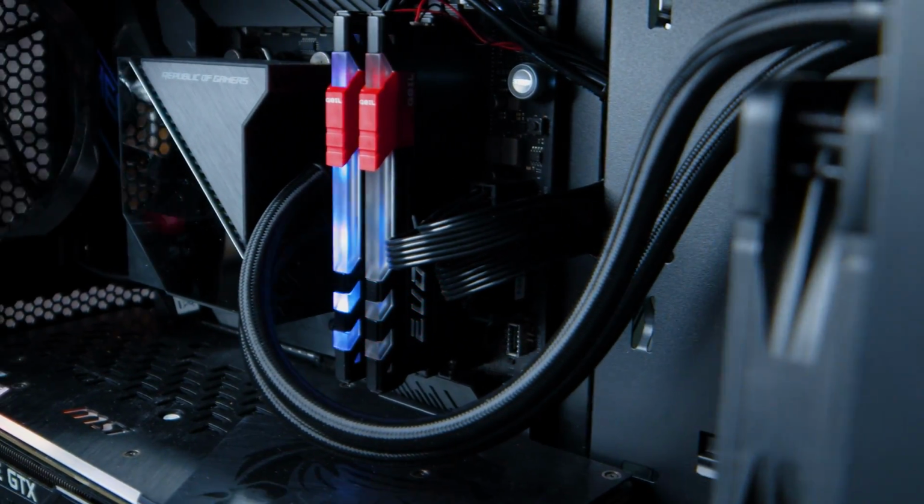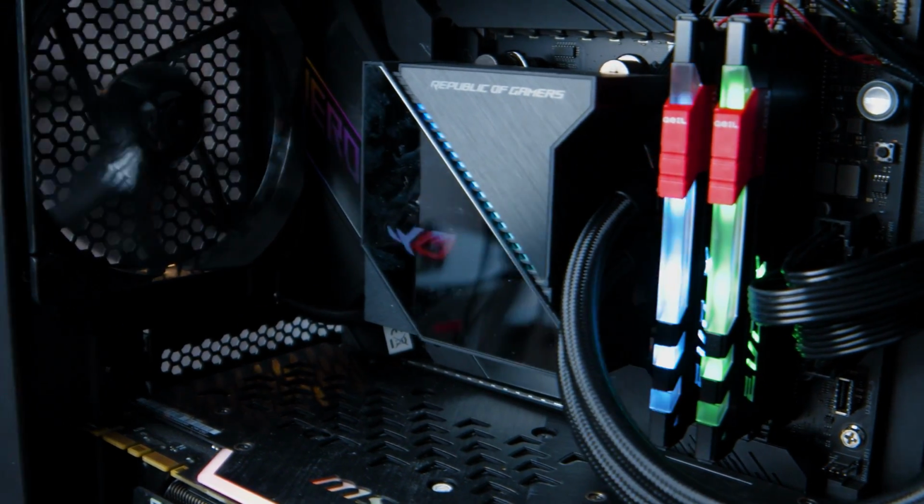You should also figure out which backplate cutouts you're going to use for routing cables to different components. Choose cutouts that are close to each component, but don't have too many going through the same one. You need the cables to be able to actually fit through, remember? If you have all this figured out beforehand, it'll be much easier when you get down to it.